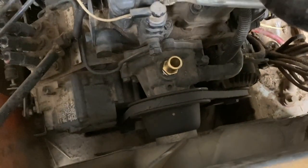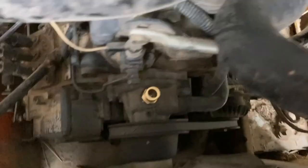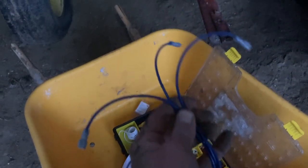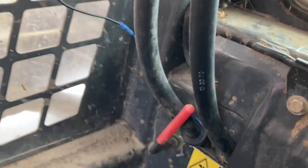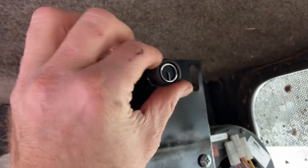We can see our valve is in there. The top nipple connection is a little easier because the coolant level isn't low enough to run out right away, whereas the other one had coolant right there running out as we put it on. We slide it on and tighten the hose clamp. We also made three little jumper wires with female plugs on each end going from the back of the fan switch to the actual fan, following the schematic. The heater is mounted, hoses go back through, everything is working, and we hooked up the fuse and made a little bracket to hold the switch — it's three-speed.